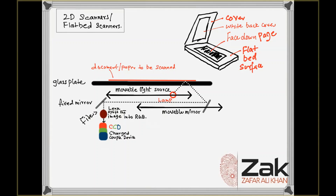That was the mechanism for the 2D scanner. Now, a word about resolution. Most flatbed scanners have a true hardware resolution of 300 by 300 DPI — dots per inch. The scanner's DPI is determined by the number of sensors in a single row of the CCD array.